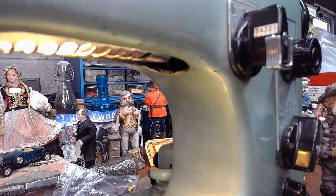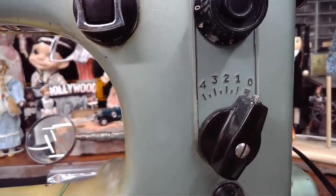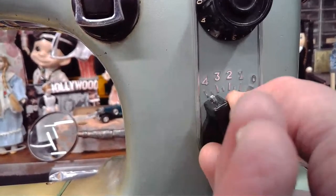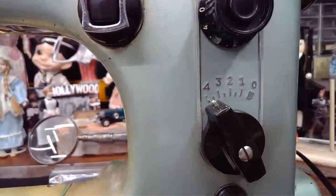And again, we're sewing with the revised B cam. And I've already set my stitch length, it's good to go, but I need to remember to move this back. And again, make sure your needle is free of the material before you move any of these knobs, because it's going to sometimes impact movement on the needle and you don't want to bend your needle.